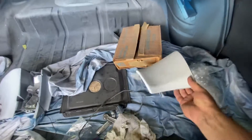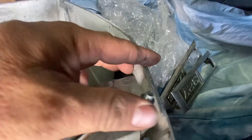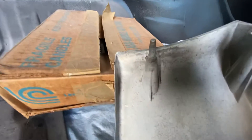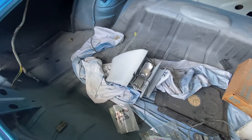The quarter panel extensions are somewhat prepped. I had a broken stud and I tapped it and put a bolt in it with a regular threaded nut instead of the self-threading nuts. This one corner now has an actual threaded nut. It'll hide okay — it's better than buying a new housing with just that one flaw.